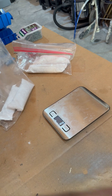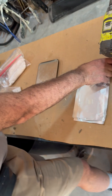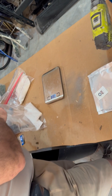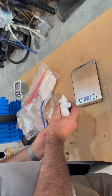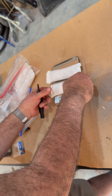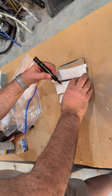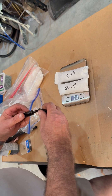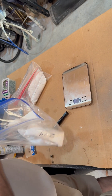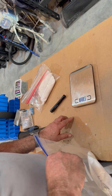I pulled the desiccant cartridges out of the container — came in from Mercedes-Benz. I kept them in a Ziploc bag. I like to weigh them before I get started, so that's 214 — I'll write that on there. I like to weigh them and write down what they are so I know what they are going into the machine, and then I can compare that to what they look like when they come out to know if they've absorbed moisture.